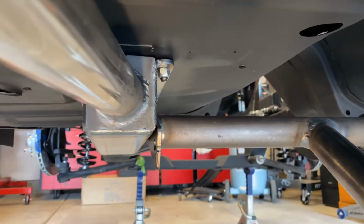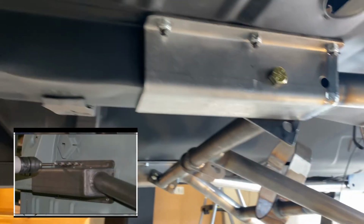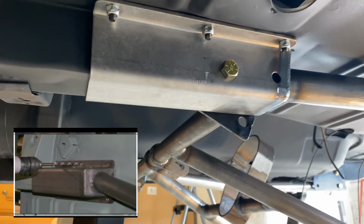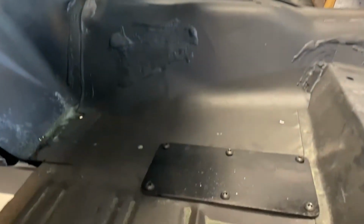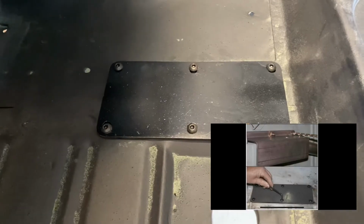Pick 7. Start drilling with the 5/16 bit. Start one of the holes, the black bolts, to suck up the frame box into the best spot. After the first hole, put the rest of the bolts in, 6 on each side, 12 in total. Make sure they're flush. Pick 10, page 4 of 14. Make sure the plates look like the picture.